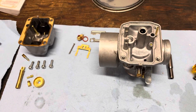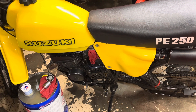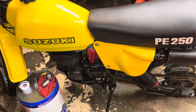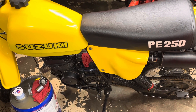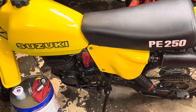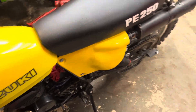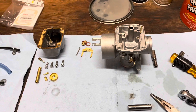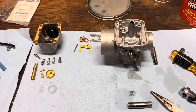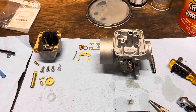The reason I'm doing this is that I took the bike out today and it was running goofy — it would only run well with the choke on, and even then it was running a little funny. When I turned the choke off it would just burble and die. That usually means something's wrong with the carb. The bike sat a lot this year so it probably got some crap caked up in there somewhere. I'll clean it out and hopefully it'll be good as new.